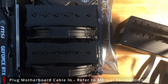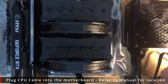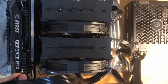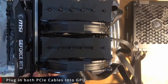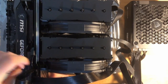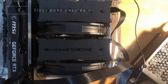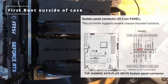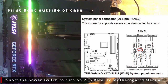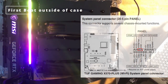So we're going to put the motherboard cable in here. Refer to your user manual to find out where these slots and ports are to make it easier to find on the board. Plug your power supply on and then we're ready for the first boot. Refer to your user manual to see which two pins you need to short to act as the power switch — obviously you don't have the power switch plugged in yet because the build is outside the case. Just use something metallic to short across those pins.